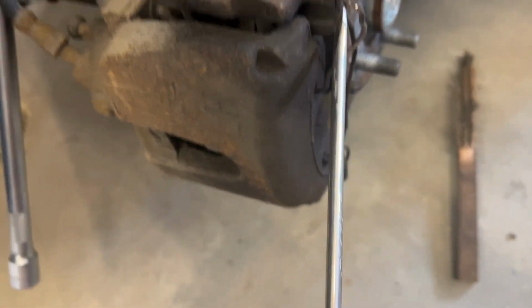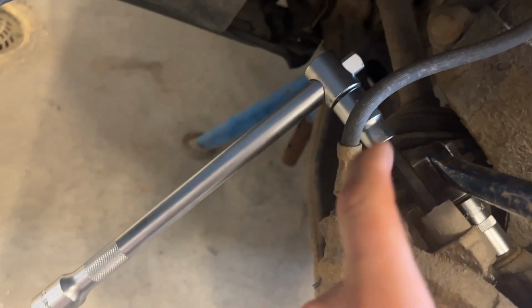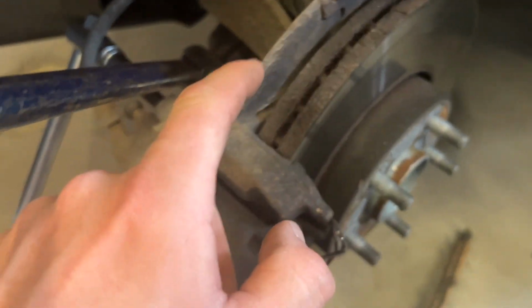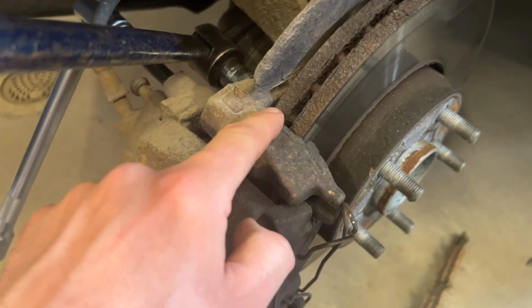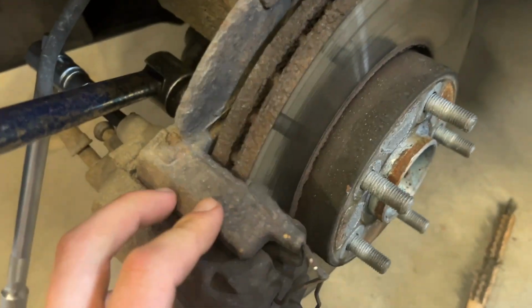Remove the tire. You just take this one, you kind of just pry this one off because it's laying like this. It had two types of bolts or nuts. This one is holding a caliper to the frame, but you also need to change the rotor, which means you also need to loosen the frame. But you're still going to have to take off the caliper and all that stuff. So you remove the caliper, then you remove the frame. After that, you're basically free to remove the brake. And yeah.